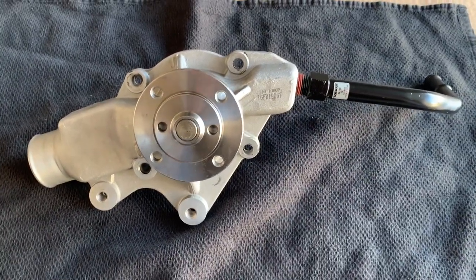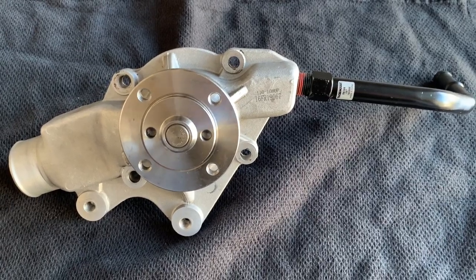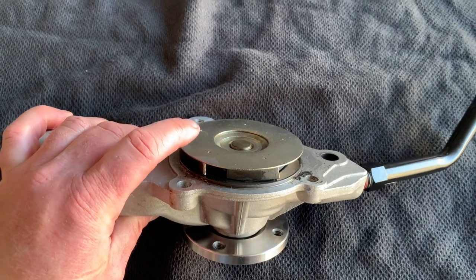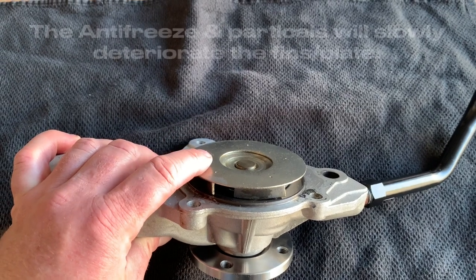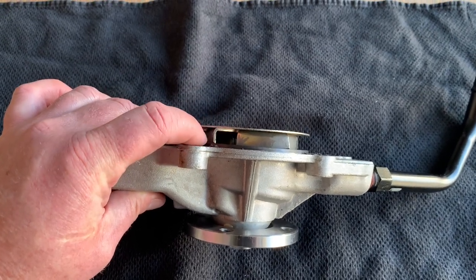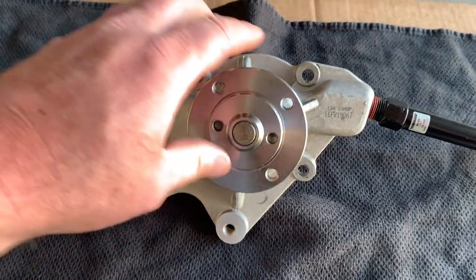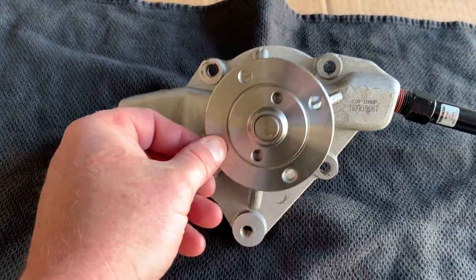This is one of the seven deadliest sins of an overheating XJ and one of the more common problems that we find. Why is it a problem? When you look on the other side, you will see on a lot of cases this plate is completely dissolved and gone. Over time, it gets worn out, rusted, and starts to break apart — as does the impeller. When the impeller fails and breaks down, there's no fluid able to transition through the system. A lot of people misdiagnose this because they still see the wheel operating and functioning perfectly.